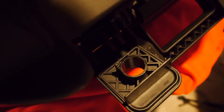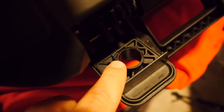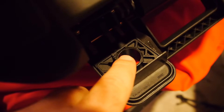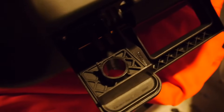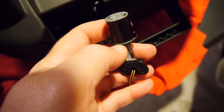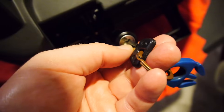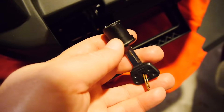Now let me show you where you need to clean. First of all, you have to clean the inside of this barrel — this is where anything you've sprayed that you weren't supposed to is going to be collecting dirt and dust. What that buildup is going to do is accumulate not on the inside but on the top, preventing the lock cylinder from fully seating down. It builds up right here underneath this lip. You can see why spraying from the top, spraying into the lock cylinder, does absolutely nothing for this problem, because it's underneath this lip.